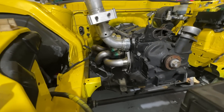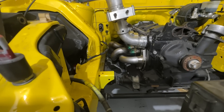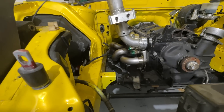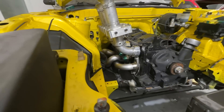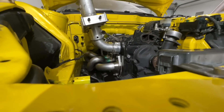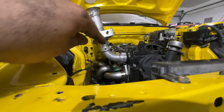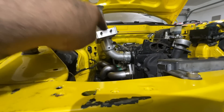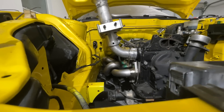Overall, super super happy with the way the headers came out — looked pretty cool. I still have plenty of space, like about half an inch before it hits the frame rails. I can take the exhaust in and out easy, and it's not too high, which would get the intake hot. I'm still gonna make basically a heat shield to cover it up so we can get that heat away from it. But it should be fine — that was pretty much it.